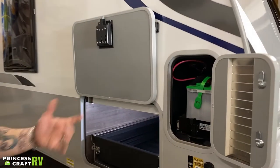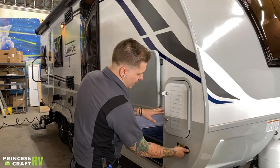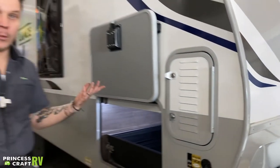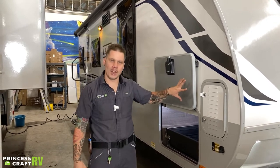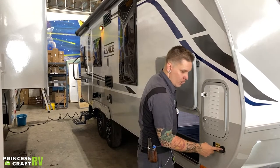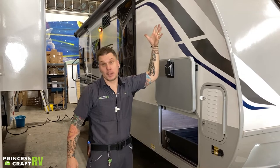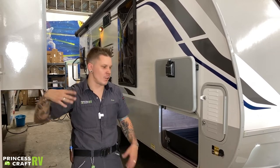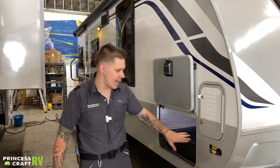On the other side of your battery bank, the same rules apply — make sure everything's strapped down correctly and fully engaged with the latch to keep everything nice and safe. We also have a solar plug here — an Anderson-style solar plug designed for any of those briefcase-folding portable solar panels, which are an excellent addition. The biggest selling point of those portable systems is that you can park your unit in the shade so you're nice and comfortable, plug your portable solar panel into this port, and then pull that panel out into the sun. Your charge controller, generally built directly into the panel, is going to do all the work — taking in energy as necessary and ceasing to do so when it's not. All Lances come pre-wired for solar on the roof, but not every scenario calls for rooftop solar.